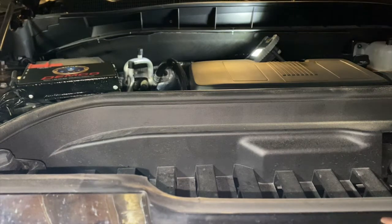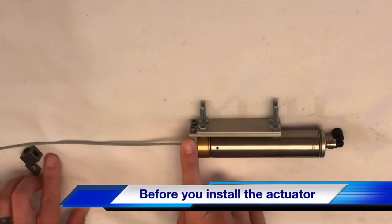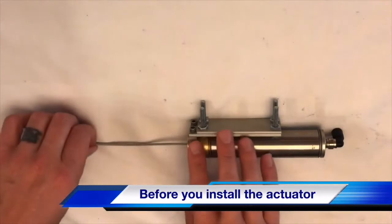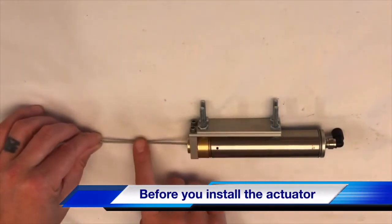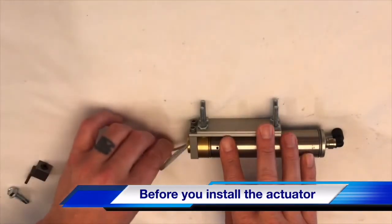Next, we'll move to the inside of the vehicle and get our actuator mounted. But before we get started, let's go over a few things. The most common reason we see cable breaks is because there isn't enough cable between the end of the actuator and the anchor on the firewall. So when the towed vehicle is being driven normally and the driver pushes on the brake pedal, it's actually bending our cable repeatedly. Eventually it's going to break where it's been bending. Ideally, we're looking for three and a half to four inches in cable length. By doing this, it allows our cable to actually coil rather than bend.